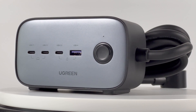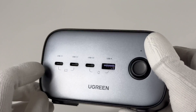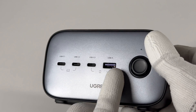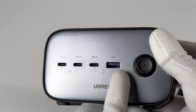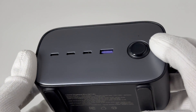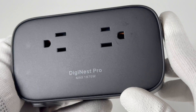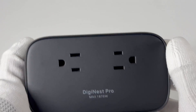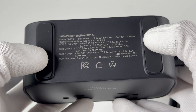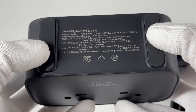Compared with the 65W version, it has one more USB-C port and one less USB-A port. The USB-C1 and USB-C2 can fast charge the notebook. The USB-C3 and USB-A can fast charge the mobile phone. The round switch is next to the USB boards. A two-prong AC outlet is on the top, and those two three-prong outlets are on the back, facing in opposite directions. There are two strip rubber pads at the bottom, and all specs in print are between them. Model is CD270.